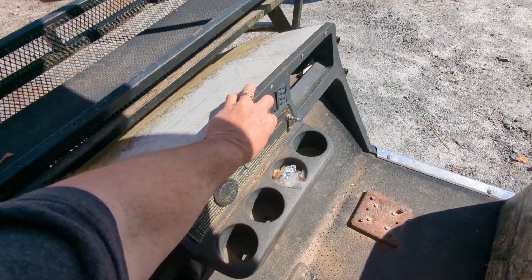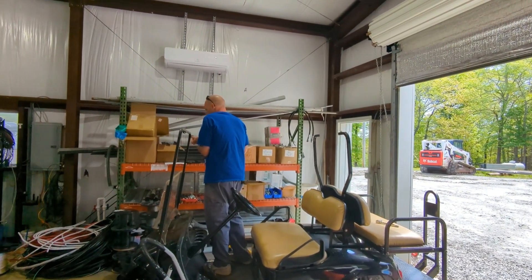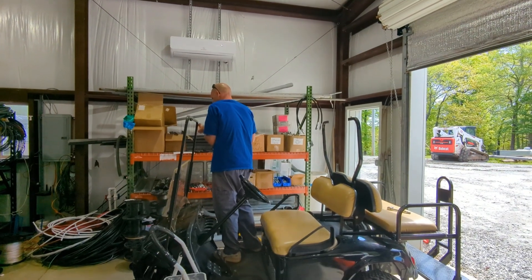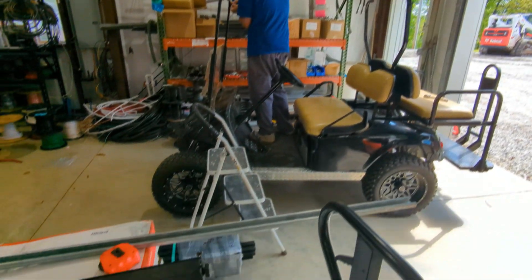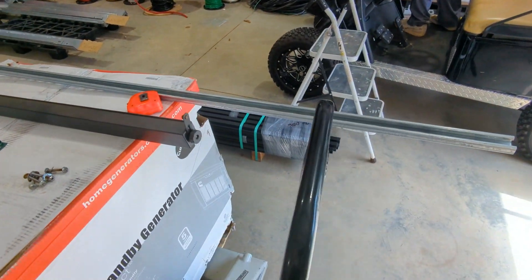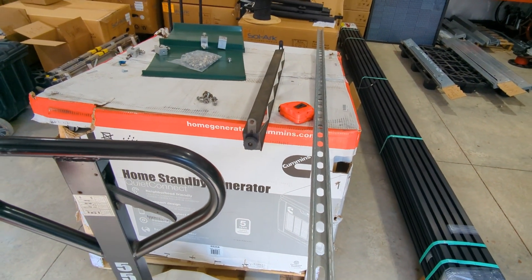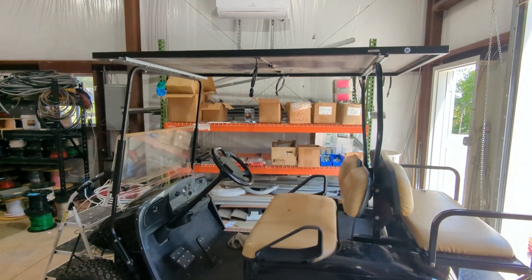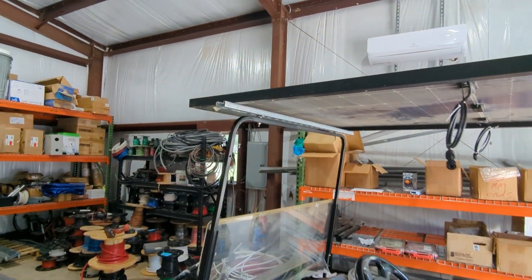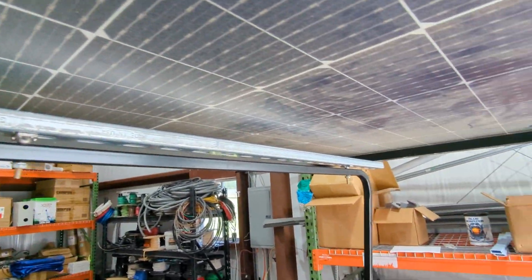So we're going to convert some carts. The first thing we're doing is removing the roof — that's the easy part. James is getting the roof off. We took that ugly mirror off, just cleaning up the top, and then we're going to figure out how we want to mount. We've found Unistrut to be the easiest and toughest way to mount the solar panels. So we start by removing the original cart roof and then adding some Unistrut across.